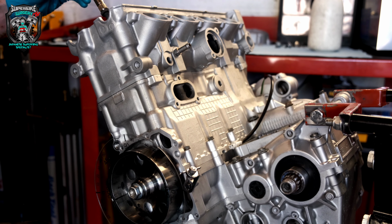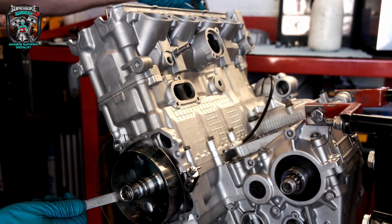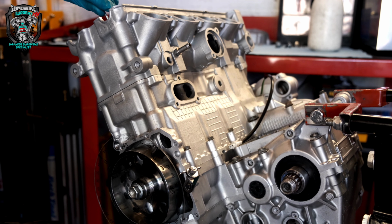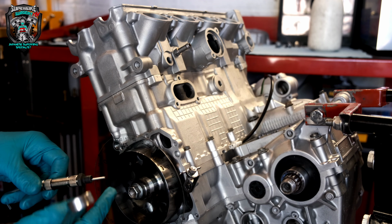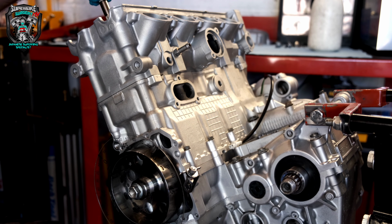So first thing you want to do is make sure that the engine isn't at top dead center, and screw the TDC stop all the way in. I should probably say, in case I'm causing confusion, the length that this is sticking out is irrelevant. About that much, basically. You'll see how it works in a second. Most of you probably already know how it works. So you screw this in till it hits home, till it seats properly.